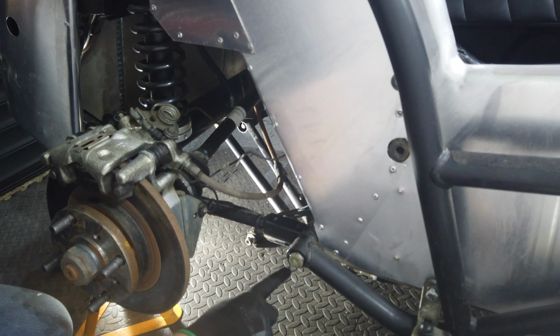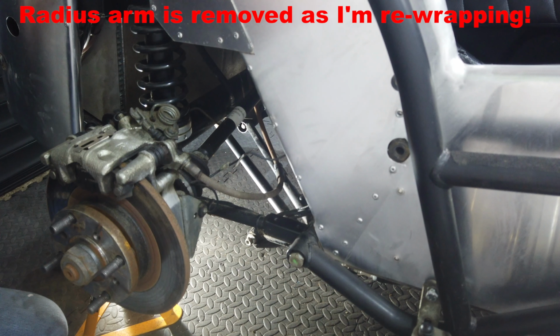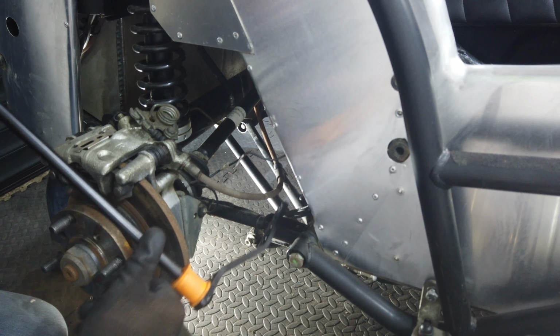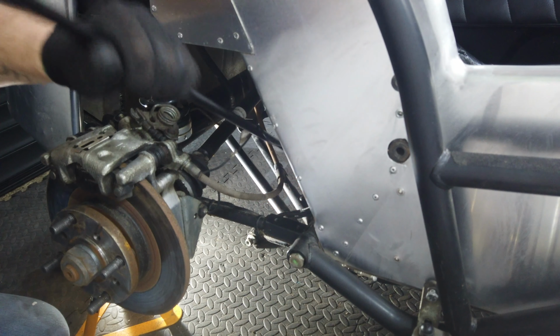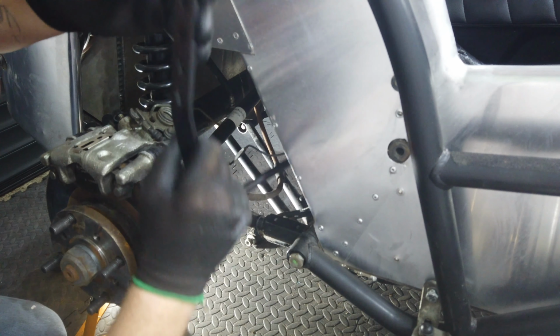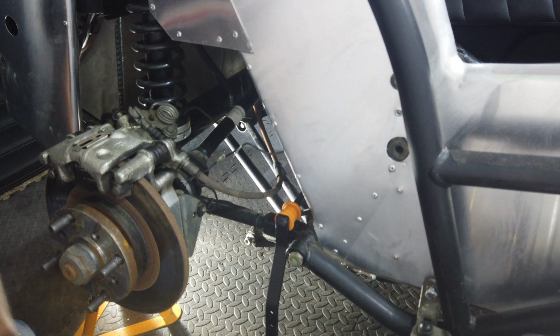On your chassis you will see the mounting location for the anti-roll bar. The first job is to carefully pass the anti-roll bar through the chassis. This can be quite tricky if you are mounting the anti-roll bar retrospectively, as there are many components now in the way, such as the differential, the drive shafts and also the handbrake cables.